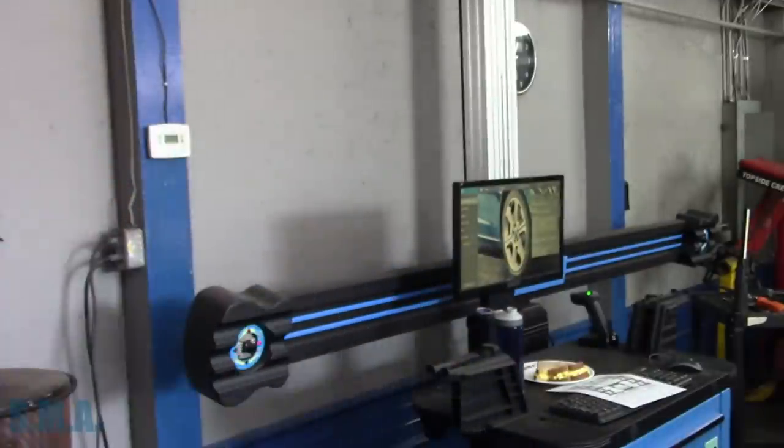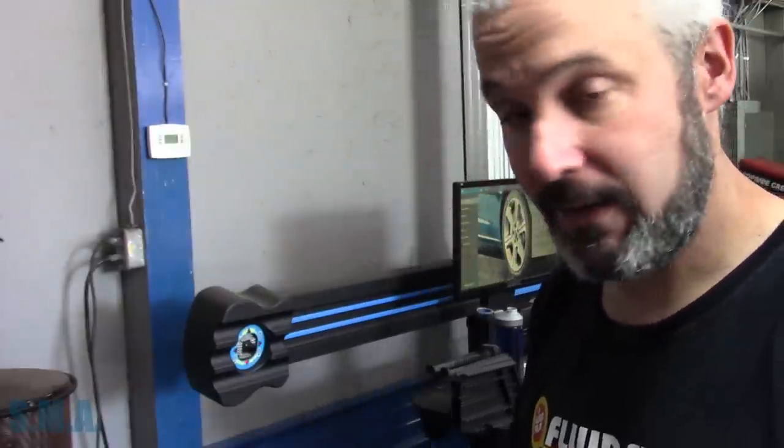That's that — everybody's happy. That's your Hoffman Geoliner 678 and your Mitsubishi 3000GT or Dodge Stealth — whatever you want to call it. Not horrible; sometimes they can be finicky depending on how fussy you are. What I try to do for customers is: if it's adjustable, we adjust it as best we can, particularly if it's right on the edge of manufacturer specs — try to move it in and get it super close. It's interesting to see on an alignment machine, especially on lighter or spring-sagged cars — sit inside and the alignment shifts just from your weight.